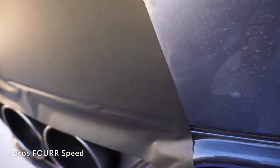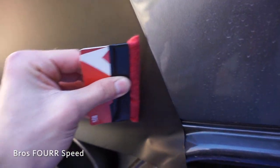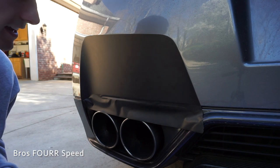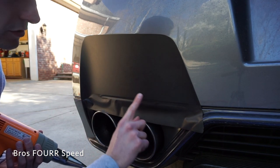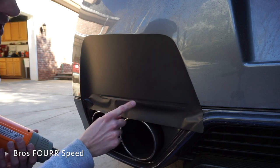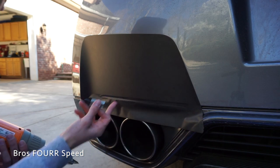Now a close-up of what we're looking at. Hopefully you can see how good that edge is. Down here there's a little bit of a gap — we want to heat up the edges and then place them back down, basically just closing that gap. We're almost done with this now. Last on the list, all I'm going to do is heat up this whole bottom edge and then use my finger to push the vinyl to touch the top and bottom piece. That'll give me a good area where I can take the razor and cut a clean line all the way across.